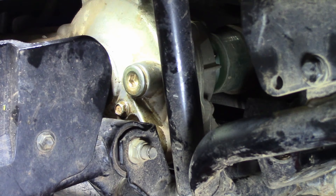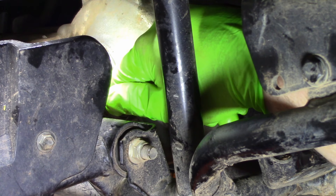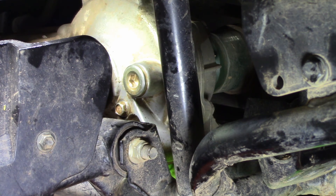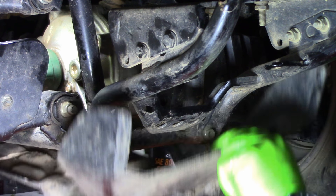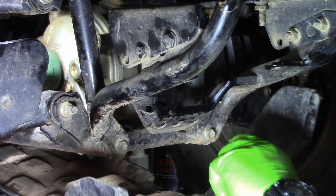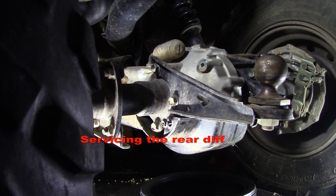It's kind of hard and awkward, but try to get it as straight as possible so you don't get it bound up. Now that you have everything torqued — you have your three ports: your service port, your observation port, and your drain. Look around and see if you see any drips before you go riding. You're ready to put your protector on — it's two 10 millimeter screws. The plastic is a bit beat up, so don't torque it, just snug it.